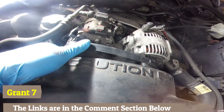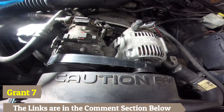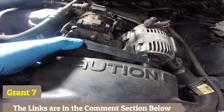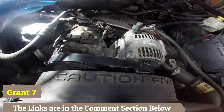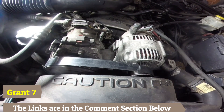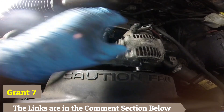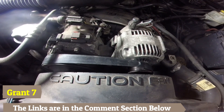This sometimes happens from an incorrect belt, sometimes just from buying a cheap belt. Usually once the engine is warm, the rubber of the belt gets soft and grips much better and you won't hear it. This happens on the first start of the day, so if you're getting in and out of the car and it doesn't do it every single time you start, chances are it's the belt. Sometimes people spray belt dressing — I've even seen videos of people putting deodorant on the belt to quiet it down. If the sound goes away with anything you've done, chances are it's the belt.